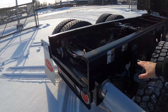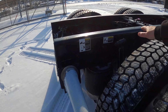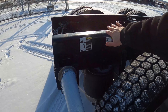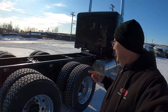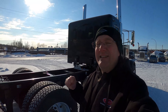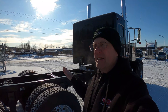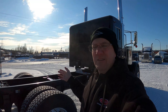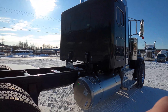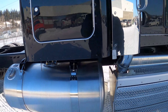Being that it's got the heavy New Way suspension, it was ordered as a low bed tractor. I brought it in with a square tail frame for two reasons: we're going to cut this and add low bed ramps. The other reason is I can avoid getting your ATC automated traction control by having this as a truck. My customers don't want that — certainly not in a bush low bed application. So no traction control on this bad boy. It's got ABS, but no traction control.